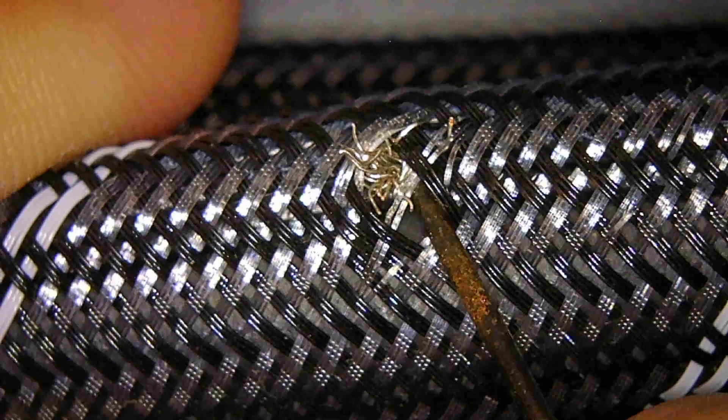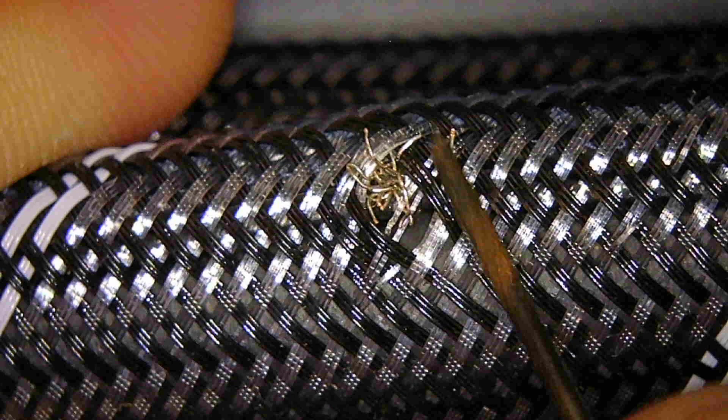As I mentioned, through the length of the tubes there were other points that exhibited this same anomaly as well. What is most likely happening is that unlike the rubber tubes and fabrics in the braiding that can easily flex and stretch, the metal wiring for the fans cannot. Because the pass-through was designed with not enough tolerance to accommodate for this flexing, as soon as you start flexing the tubes at a more aggressive bend — and I can actually feel it right here — the tension of the wires rips off the solder joints where they're secured. When the tubes return to a more neutral position, these wires want to move back but can't if they're stuck somewhere, so they find another way — through the insulation and even out of the tube's braiding.